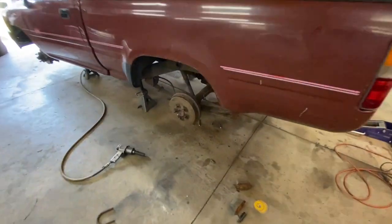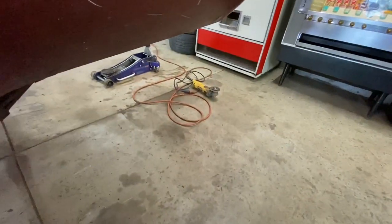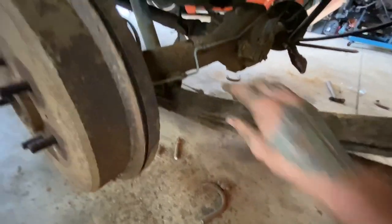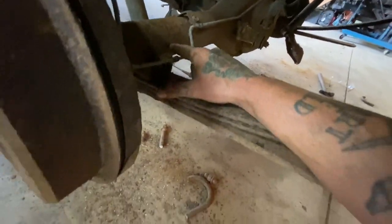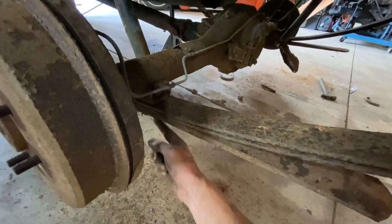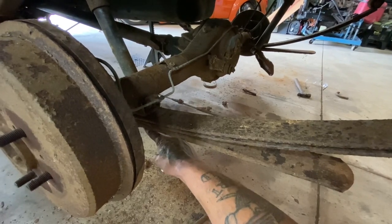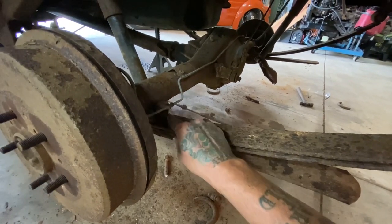So let me show you guys where I'm at before I go any further. I tried to be nice with the U-bolts and the impact, but they didn't want to be nice. So out came the death wheel. I got the U-bolts out. And if you have to cut yours, there is a little bit of tension on there just from this spring pack, so I always put a jack under the center, jack it up a little bit, cut them — just so nothing flies apart on you.